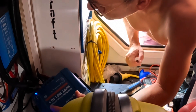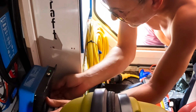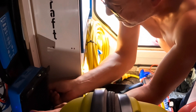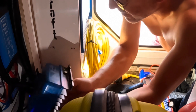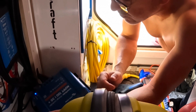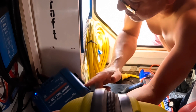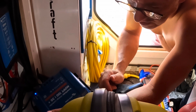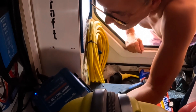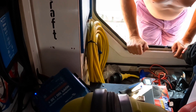The communication cable — which communicates with the rest of the Victron system — is unplugged. I'm not sure whether it's just become unplugged or whether I pulled it out, so I've plugged it back in. The bulk light is now flashing blue — not the Bluetooth light — meaning the unit thinks it's charging. I'll go and check the Victron control panel inside and see if it agrees.